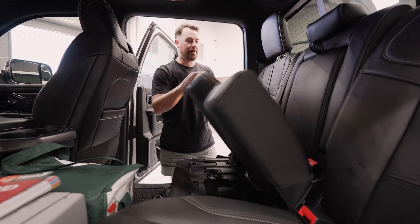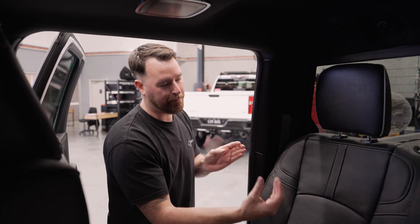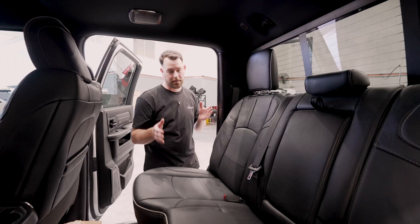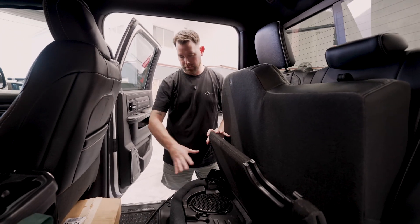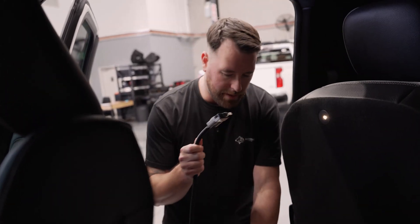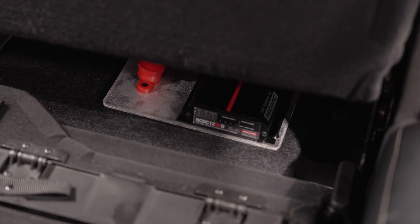When it comes to the behind-seat battery setup on the Ram 2500, you can't easily pull the seats forward and in the back there you've got very little room to squeeze in a decent-sized battery. We've even had to delete one of the little air vents on the back wall to get the bracket in there and squeeze in the 120Ah super slimline lithium. This battery here isn't big enough to run something like a 2000-watt inverter — that is one of the limiting factors in doing a battery inside the 2500. Under the seat there's a little subwoofer from factory — we could remove that if sound isn't your thing and add in extra battery capacity or do something more custom. But for now this setup on the back wall is super neat and simple, with the grey Anderson plug inside the vehicle to plug into a fridge inside the cab. Underneath the back seat we've got the RedArc BCDC 50-amp charger, so while the vehicle's driving that one keeps the battery topped up nice and quickly.